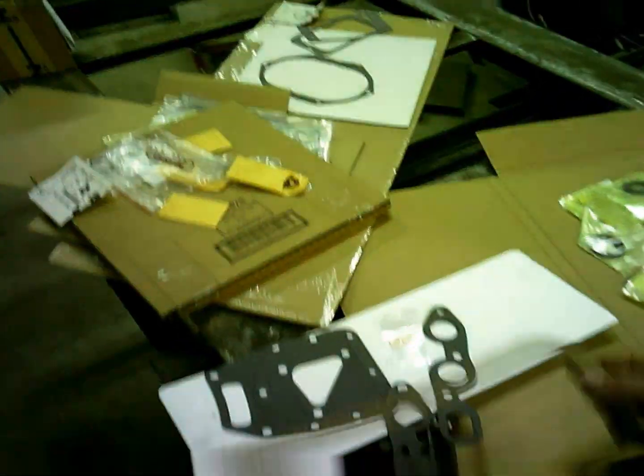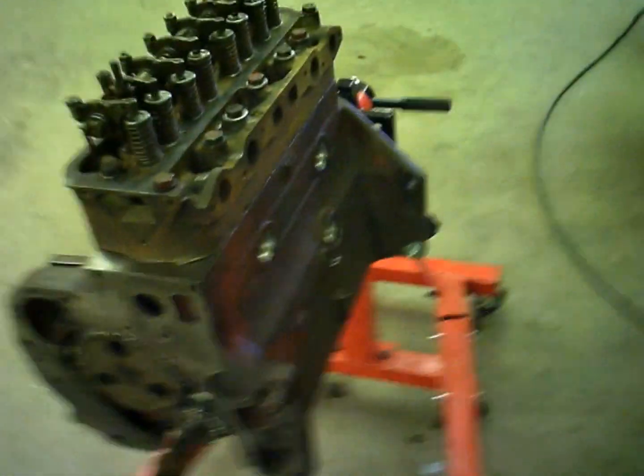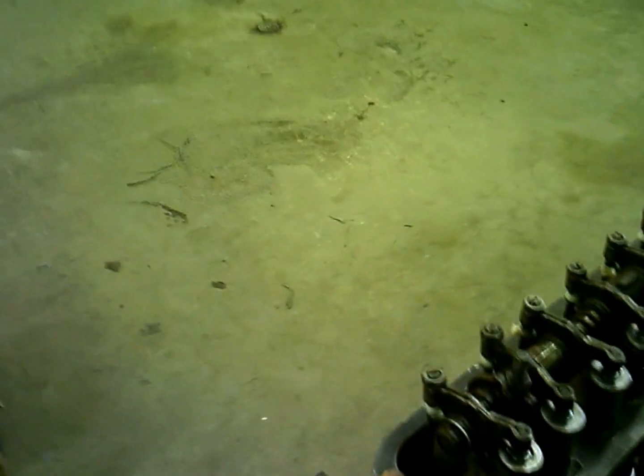which you always hate valve cover stuff. Caterpillar's got pretty good valve covers, or at least on the 3208s, they're a cast aluminum deal, and you can kind of tighten them down a little more. But they just use a rubber gasket, which will also squish out.